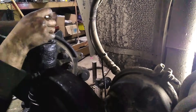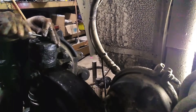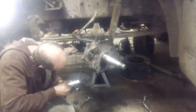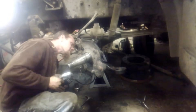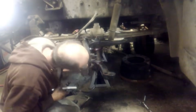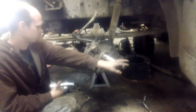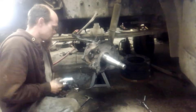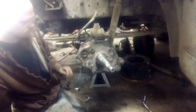Install your top and bottom cap, then your grease fittings, and grease the kingpins. I like to move the spindle around as I grease them. Grease until grease comes out the center. Your new kingpin and bushings are finished and installed.